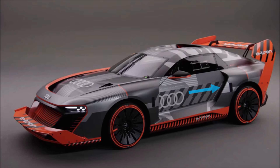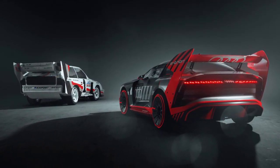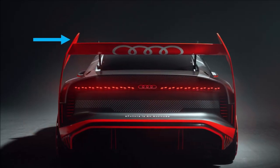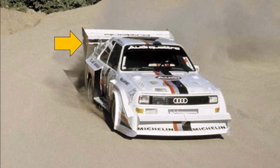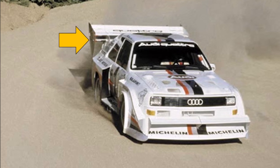The side intakes at the rear wheels are blanked as far as we can see at the moment. Instead of the multi-element rear wing, there is a large single element now with modern swan neck mountings that run through the rear window. Audi kept the massive end plates but angled them at the top. The original job of them was to increase the frontal area at the back while drifting to counteract the side force — or in other words, to be able to drift faster.